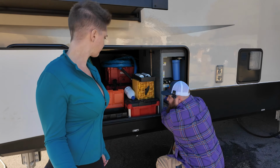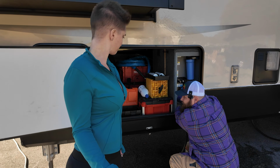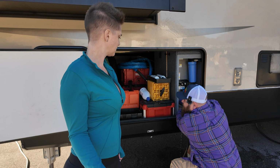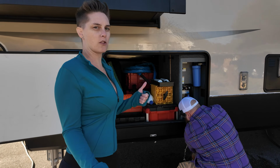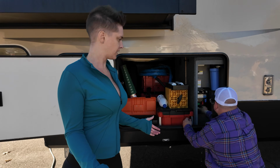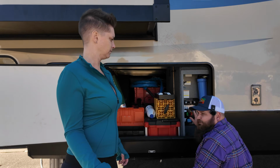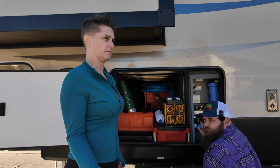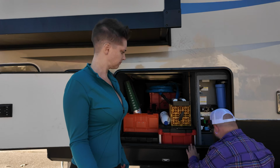it to dry camping mode, which basically means from the freshwater tank to the fixtures, but I'm still gonna keep the hot water bypassed so that way none of this gets into the hot water heater. Fantabulous. So we have our bleach water mixture and the fresh tank full of just fresh water at that point. So just keep that in mind that if you're doing this process, if you follow the images, dry camping mode is not enough. You have to know which switch is your hot water heater so you can make sure that one is still bypassed when you get to this point.